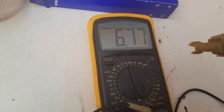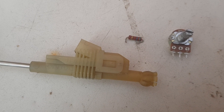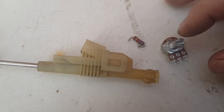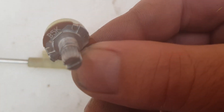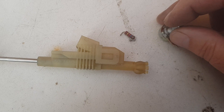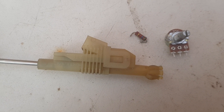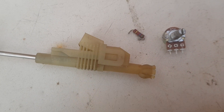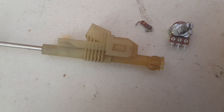Here's another video about how to repair the Volvo clutch position sensor. This time, instead of using a standard fixed resistor, I'm going to use one of these — a little 5k potentiometer. The beauty of using this is we'll be able to vary the resistance and set exactly what the sensor is seeing. It also gives us the option that if in the future the resistive tracks inside the sensor degrade, you can just alter the resistance again to bring it back into tolerance.